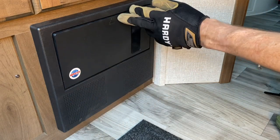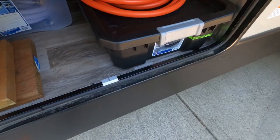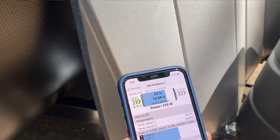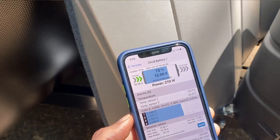That fan sound means the converter is seeing AC power and is powering up. We have power back in the trailer — both good signs. When I turn on the battery cutoff switch I should see the battery charging for the first time. We can definitely see charge current flowing into the battery, though it's not as high as I'd expect. I'm not too surprised the converter wouldn't run at full capacity all the time, but it's something I'm going to keep an eye on.